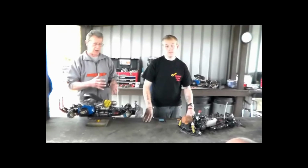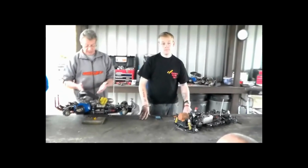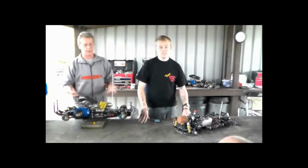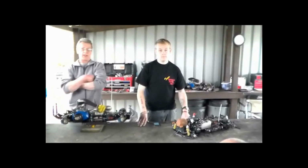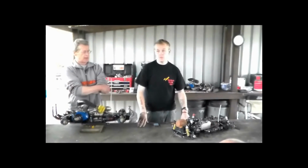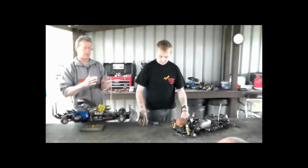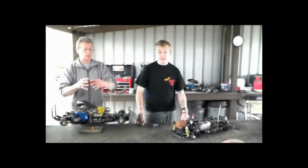So you have to gear your car up for the infield, which, believe it or not, is the same gear ratio as here. What it means is when you're going down a straight, you're hitting full speed after 10 metres, and you're just sitting there, car's going full speed down the straight. And you think it's a slow lap time, but it isn't, because you've got all the infield. So you always gear your car for the infield corners rather than the straight.